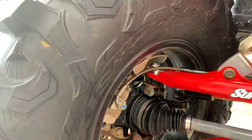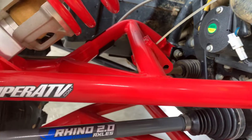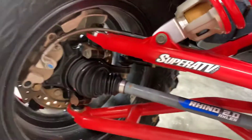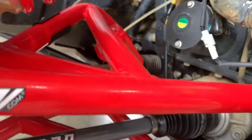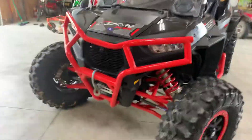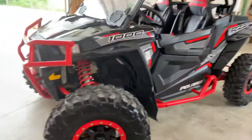I went ahead and had Super ATV put in the heavy duty ball joints when I got the A-arms, so it came all ready to install and it was really easy. They've got grease fittings in them — this one up here is kind of hard to get to, but they already had all the bushings and everything in it. It didn't take me long to put them in. If you've messed with the brakes and the wheel bearings, then you pretty much got it. A couple of the bolts are hard to get to, but I just had one of my buddies help me. They're the high clearance A-arms, and I got the stock offset so I didn't want them to stick out more and throw more mud.